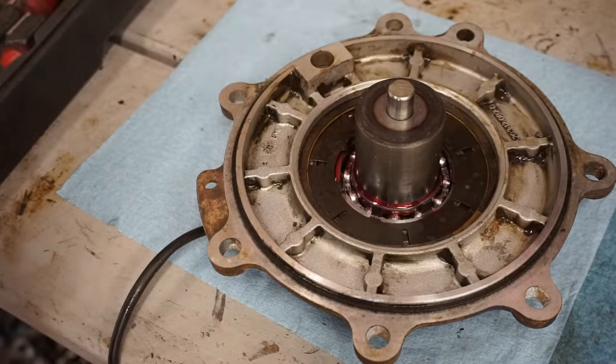All right, piston rings are on. Arrow points towards the exhaust side. We've got the ends right there facing up on the rings. And you want to rotate the rings so that the top and the bottom ring are 180 degrees apart. You want to make sure the oil ring gaps right here are apart as well. Otherwise, oil can seep through the ring gaps if they're all lined up. So you want those staggered. And yeah, that's basically it. We got one clip in there already. That's already prepped. Now we can install that.